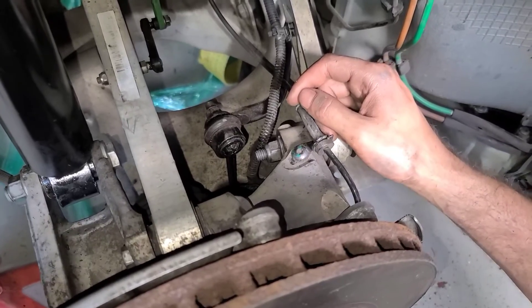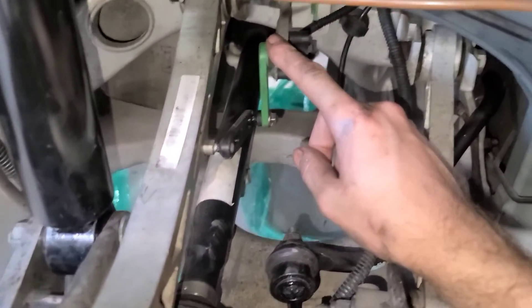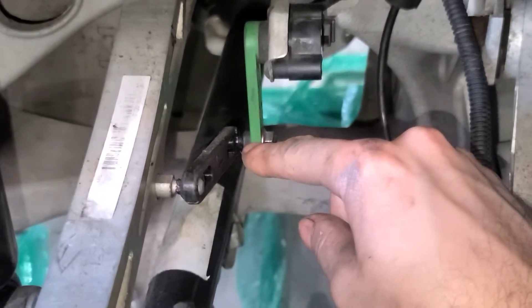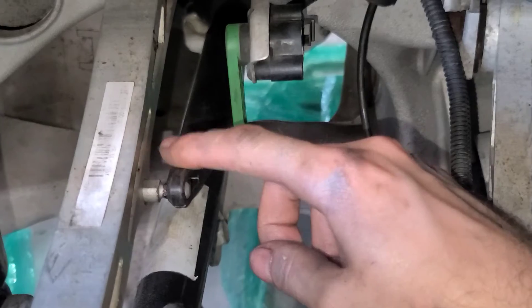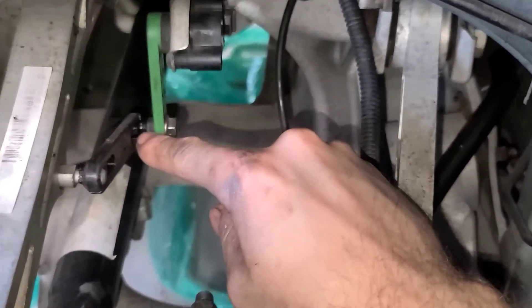Highly recommend replacing these links right here — these are the level sensors. This tells the air suspension how high your car should go. We have created an update to these air suspension links: we use a plastic link that we custom make in house, using a special impact resin for the balls. The reason we do this is these usually tend to seize up, and this product that we have made does not seize up.